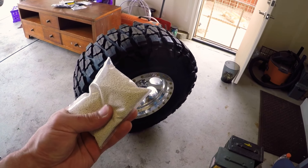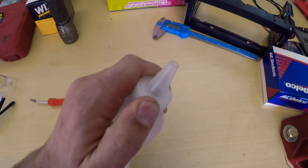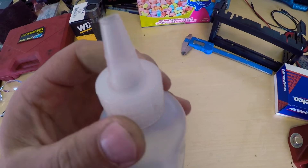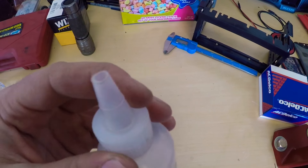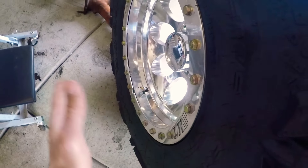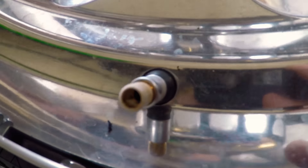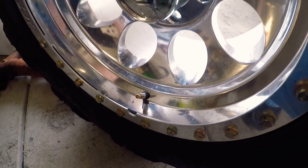There are a couple of ways to do this. I'm going to do it the super tedious way — you take the beads and put them into this little snuffer bottle. Ideally, if you were friends with the guys at the tire shop, before they set the bead you could just dump them in between the wheel and the tire. But I'm going to dump them in through the valve stem core. I did it on this truck before — it takes a while, it takes some patience, but you can do it yourself at home.